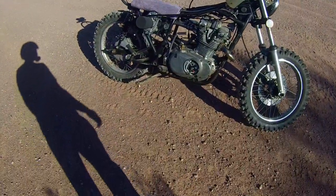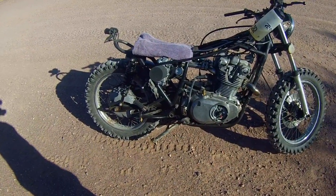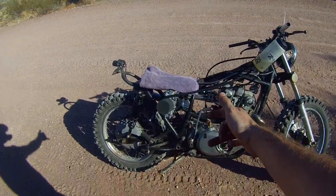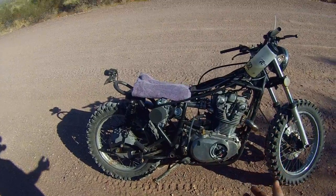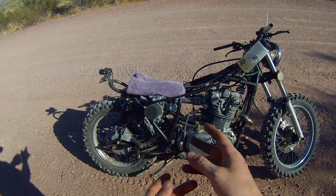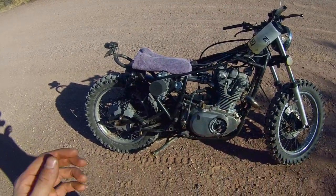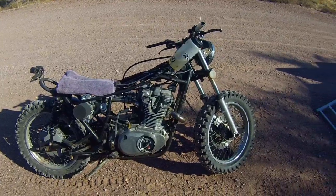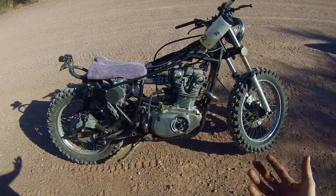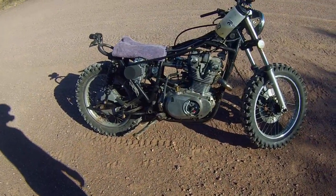Alright everybody, here's the deal. I did my best to try and get this GT15 to work, and unfortunately I think I'm going to have to admit defeat on this one. The plan is I'm going to buy a GT12 and install it. I don't know if I'm going to have to change the exhaust manifolds or the intake, and the oil drain might be different on those as well, so that's going to be a pain. We're just going to have to step down and do a GT12, and if I can't get that to work, I might have to rethink this whole turbo system design.